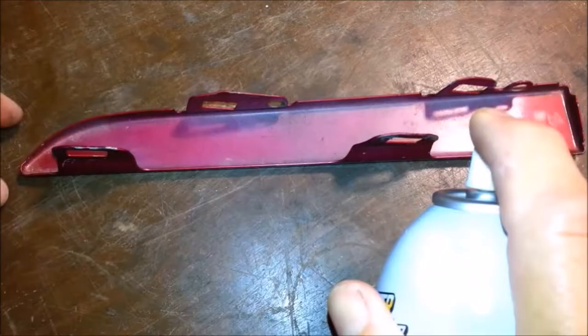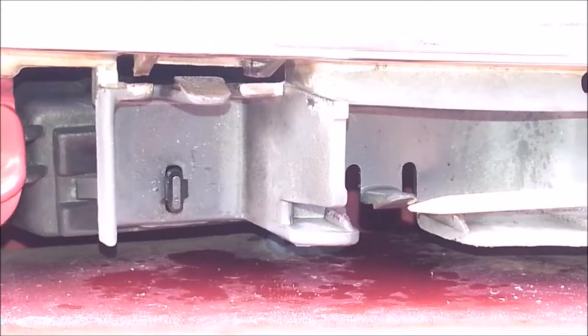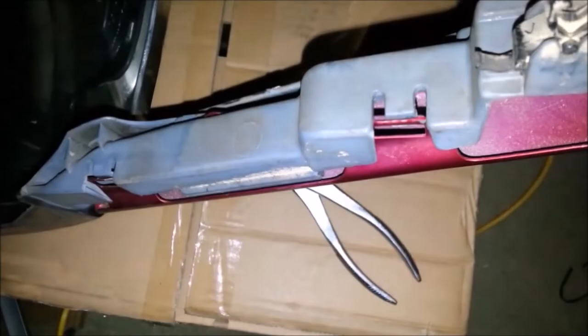To make installation easier, use silicone spray or silicone grease on the filler tabs and slots. The metal tabs have to go between the plastic tabs. Make sure you don't put the bottom metal tabs below the bottom plastic tabs. Test the grill filler fit while the grill is out of the truck. If the filler is too tight or too loose, bend the metal tabs as needed.